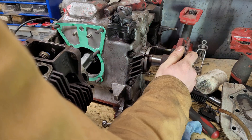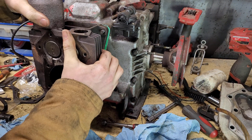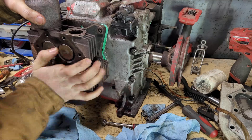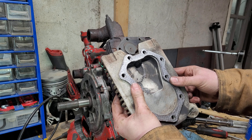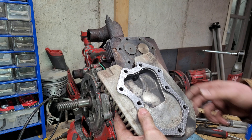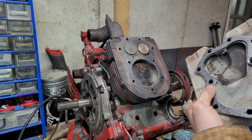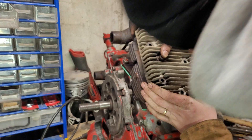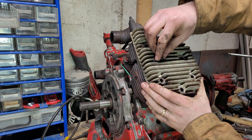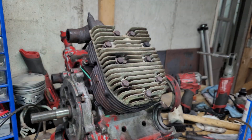And with that, our cylinder is ready to be reattached to the block. Just remember to turn the engine so that the piston is as far retracted as possible, then you can just push the cylinder the rest of the way in. Now, at long last, it's time to put our new head gasket in — remember, the head gasket, the whole reason we started all this? Truth be told, I'm not sure how I actually feel about this head gasket. It's not metal, and it's not as thick as the original. But as of the time I'm editing this video, I do have about 20 hours of runtime on the engine and so far so good. With the head placed back on the motor and all the bolts tightened to the correct spec and in the correct order, the motor is ready to go.